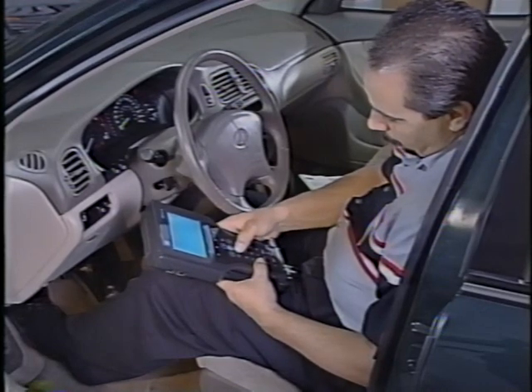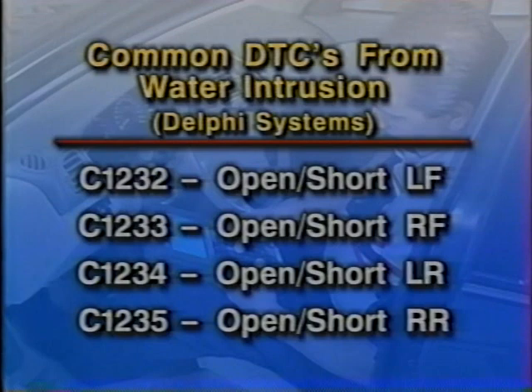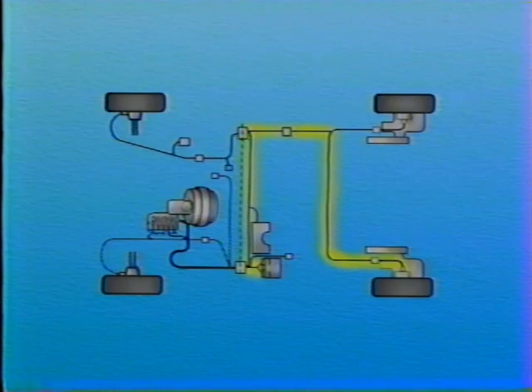If water is the problem, various codes are possible. But on recent Oldsmobiles with Delphi systems, you're most likely to see a code between C1232 and C1235, indicating an open or short in one of the wheel speed sensor circuits. If you find one of these codes, you'll know a wheel speed sensor circuit is involved, and you'll know which one. Without a code, you wouldn't have a clue where in the system the trouble was — but remember there might recently have been one. These history codes are cleared after 100 ignition cycles with no return of the intermittent.